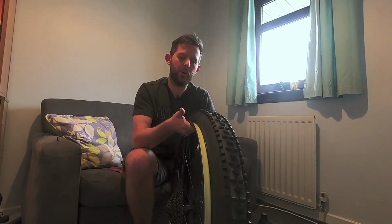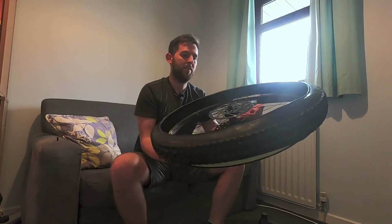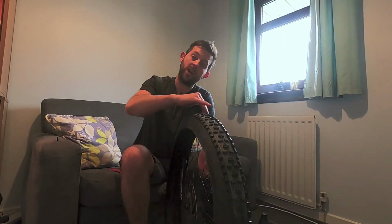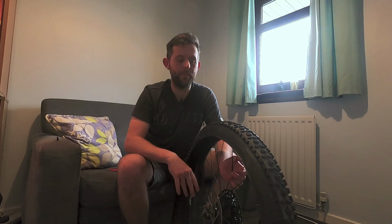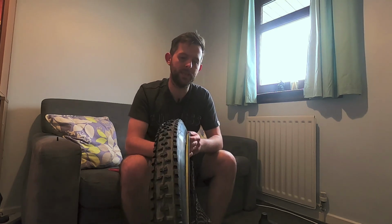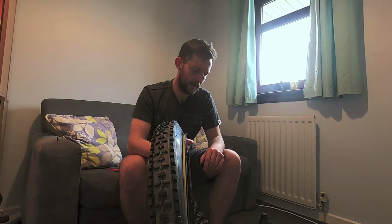So once you've got it into this point, it's tempting to just think, well, I can just get the insert in there. But again, from experience, I can tell you that's really not that easy. Because the tyre's not right up onto the bead, the cavity space is a bit less than you expect, and actually getting it in and all the way in over the lip of the rim, I don't know, it didn't really work for me. So I would recommend that you go the extra step and actually get this seated onto the wheel properly before you proceed.